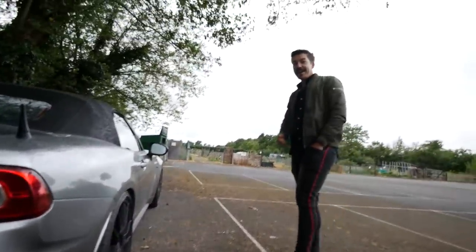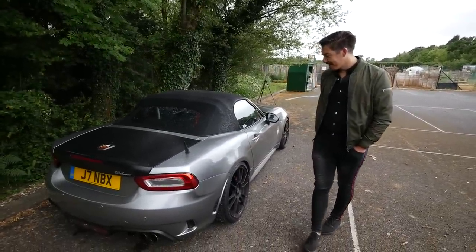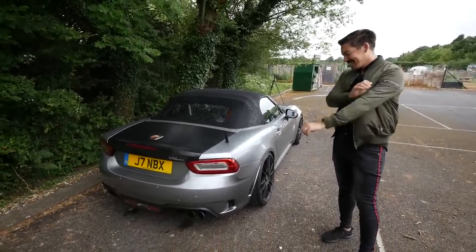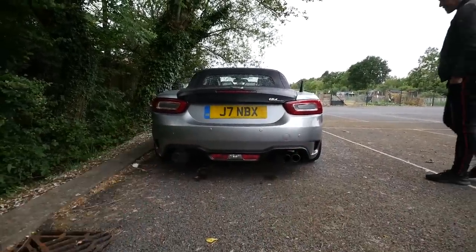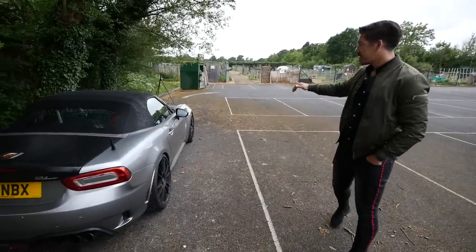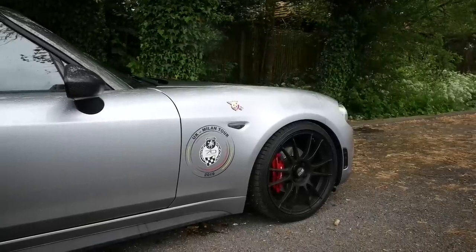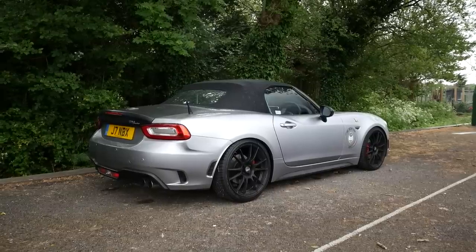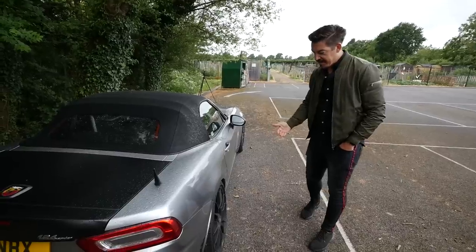The debate is out — does this look cool? I think it looks really cool from the back because it looks so much wider. You can just see the tyres are poking out a little bit. There's a staggered fitment — plus 20mm IL Motorsport spacers on the front, and plus 25mm on the rear, which is a big spacer. So you've got a very wide stance at the back with six degrees of camber.